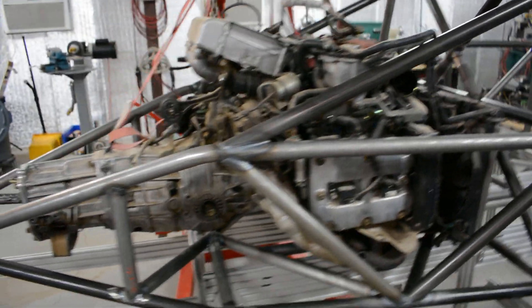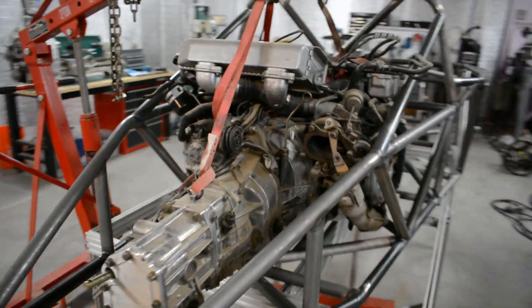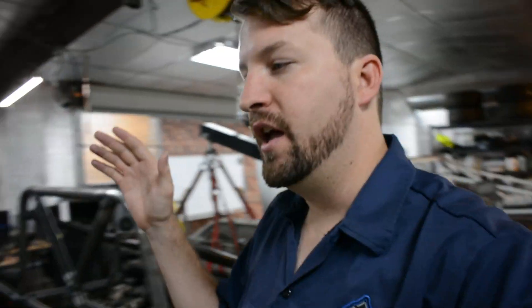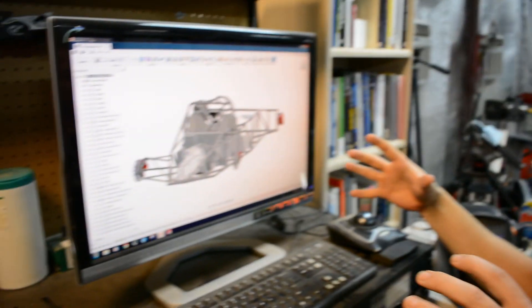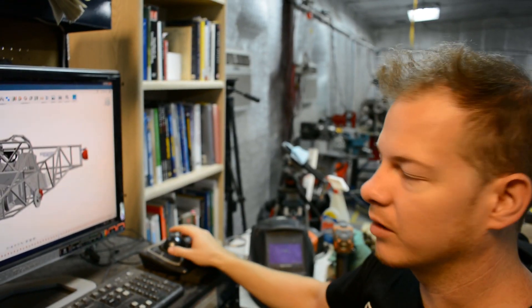Let me show you guys where we're at on this beast. What you're looking at here is the engine floating in the position it should be in. This rubber mount right here needs a bracket that attaches to the frame — that's what we have to do today. We have some raw material, welders are already set up, we are ready to go. This is going to be a vlog because we want to get more content out on a more frequent basis so you guys don't miss as much. There'll be plenty more in-depth, cinematic productions coming, so keep an eye out for that. We need to roughly lock the engine in place because right now it's all wobbly and not stable, so we can take proper measurements and design our mounting brackets.